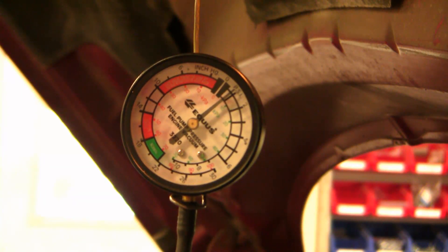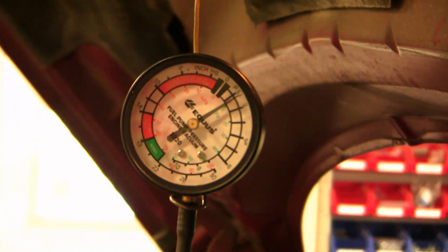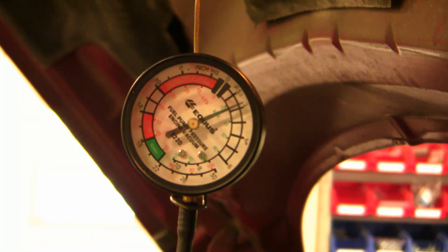Clearly there is no vacuum here. What we're seeing is a normal result with a gentle creep of positive pressure from unvented blow-by gases. Of course you don't want to do this for very long because it puts strain on seals and gaskets. Chrysler says never to let that pressure reach more than three inches of mercury, and I stopped at just under two. With this normal result, Chrysler says that pan failure is not likely and no further testing of the plenum gasket is justifiable.